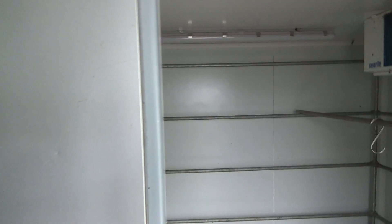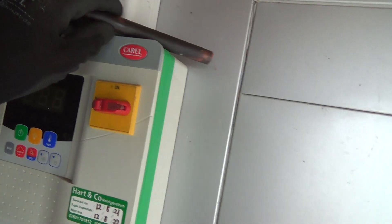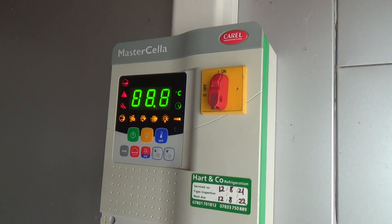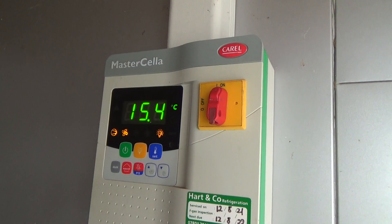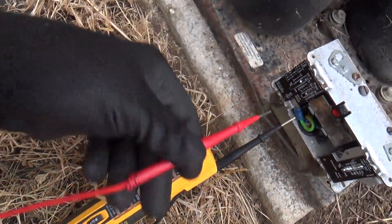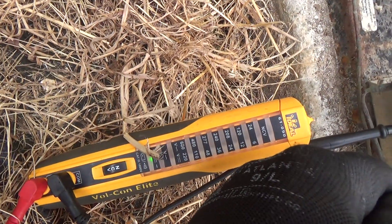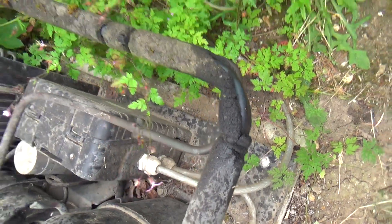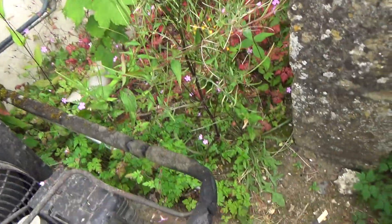Back out here again and it's raining again, like last time. Last time we had this pipe rub out on the dryer, which we sorted. Apparently it's not working, so we'll see what it does. We've got connection to ground, that's going up in neutral, and we've got live on there, so it's off on the switch. Just spotted that's all oily there, so I think we've got yet another rub out - previously it rubbed out on the dryer, so now that's gone.